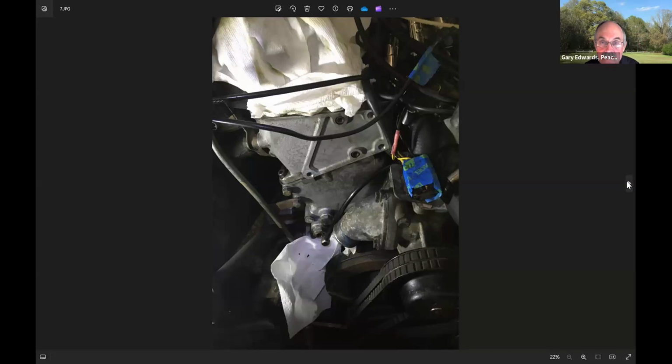Okay. So this is a picture of the front of the right side timing cover after the alternator has been removed. And I include this to point out the special tool that you need to do these guides. Here and here are pins that are internally threaded that one must remove to pull the guide, which is back in here. And I'll also point out my FME covers here. I've got this opening here stuffed, and this area where you could drop things down into the timing chain cover is very heavily protected. Although for this work, since the guide's got to come out, you've got to pull some of that out. Now, to remove these internally threaded pins, Mercedes sells a special tool, which I have, which is a slide hammer. And you thread a rod in and use a slide hammer to pull them out.